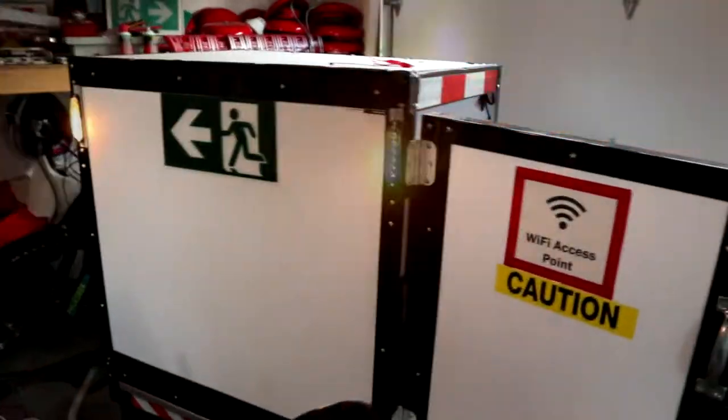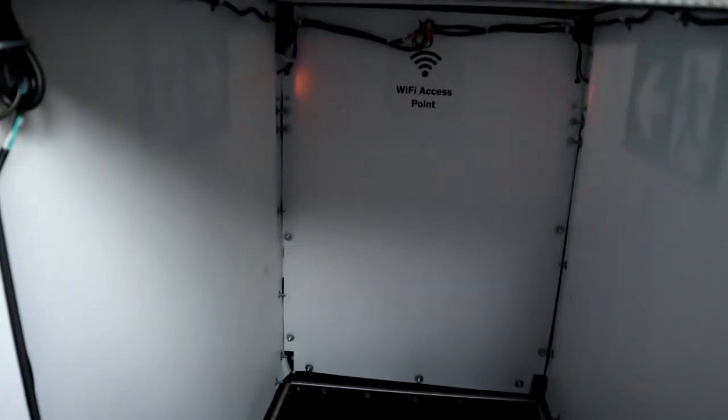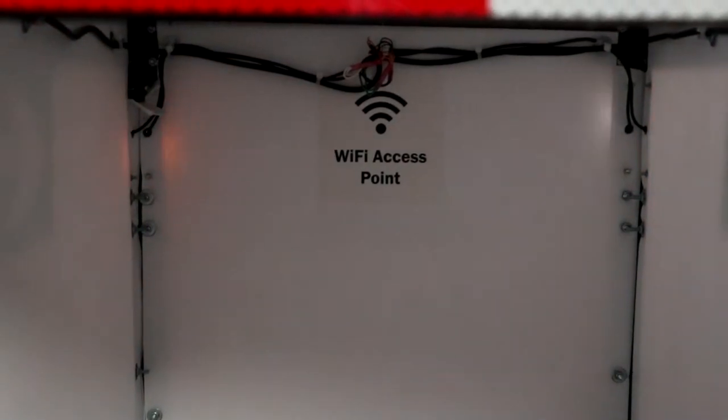It's a few hours later and I actually got that one synced. I just chopped off the sync wire close to where it was spliced and cut into one of the positives so I could get it synced. They're flashing at the same speed at least, and every once in a while they'll happen to be flashing at the same time and be in sync. So now it is time to install the light bar.